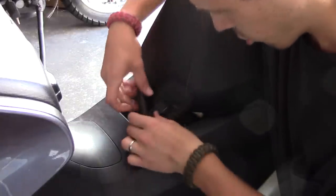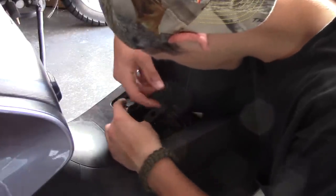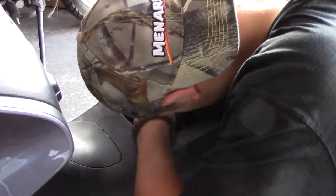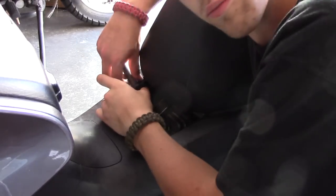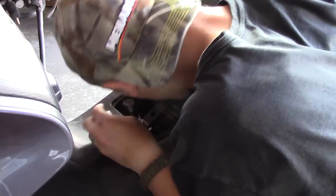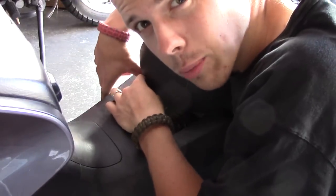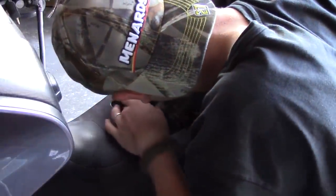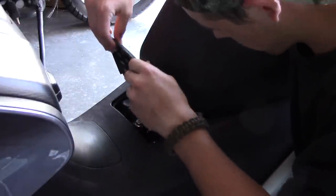All that's left to do is put the boots back over the spark plugs and you're back in business. This can be a little tricky because the boots are so long, but once you get it down the hole there's really not much to do — just push it in. This one I found more difficult than the first, but if you look underneath the seat, you'll find the tip of the rubber has enough play in it that it'll kind of just snap into place. Just push it on until it seats. Putting the cover on is just the reverse of taking it off — wiggle it in place underneath the seat and slide it forwards.